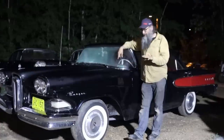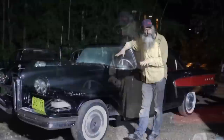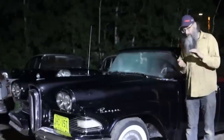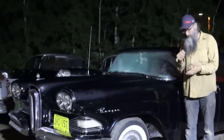So we took all that out and then reassembled it with just the fuel pump part of it hooked up. It seemed to have a lot of free play and then it would work fine. If you push the arm down all the way, it would pump like crazy. There was nothing wrong with it. So I put it back in the car and it wouldn't work.